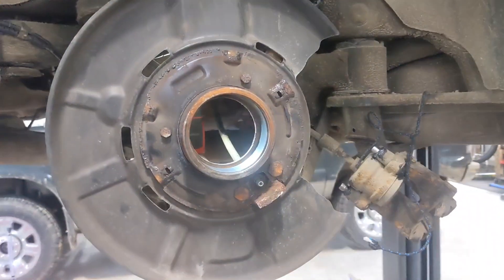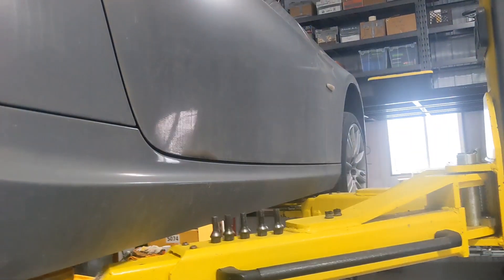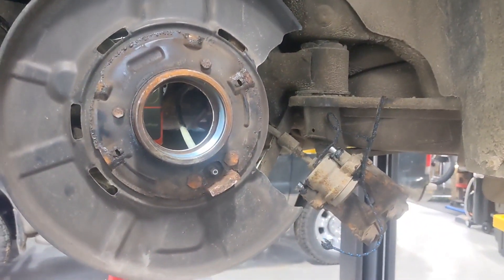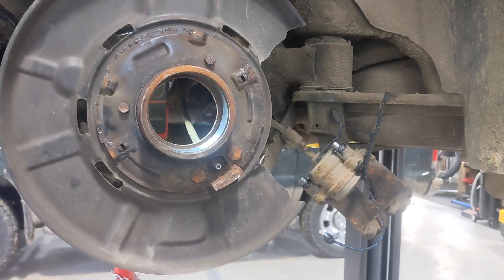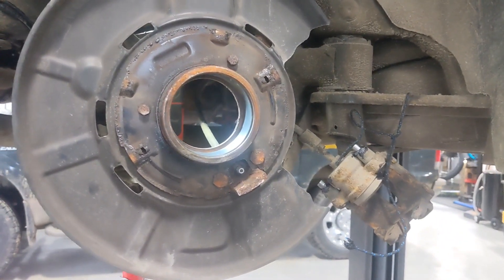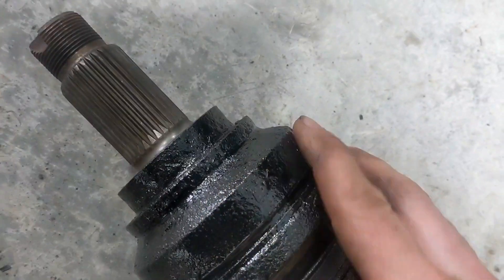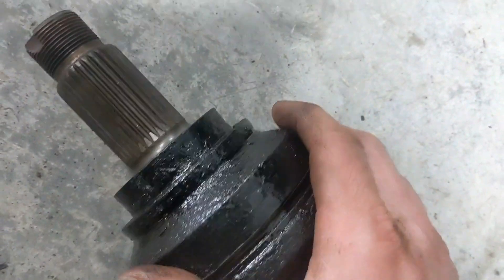I was looking for a video on this. This is my 335xi, it's an E92 chassis, a 2011 with an N55 in it. I think the older E-series chassis had a different reluctor ring on the axle. This is the axle out of this car — it was rusty so I painted it up — but as you can see, there is absolutely no reluctor ring on this axle.